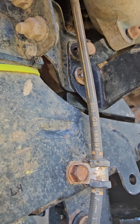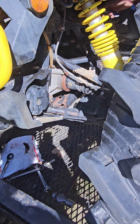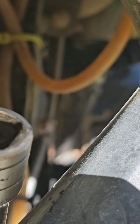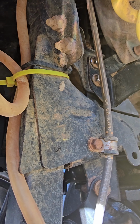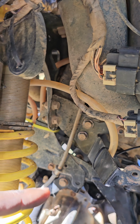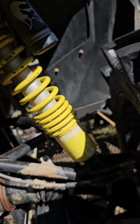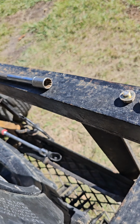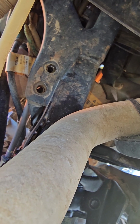On the Renegade, you can leave the two side ones, and these are the two that need to drop down. We're gonna go in and hit those from the inside through the fan. Those two right there, and again, not these two on the side, but these two in the front. The right side bolts were not welded, but they broke. We're gonna try the left side. Left side didn't break, they came out.